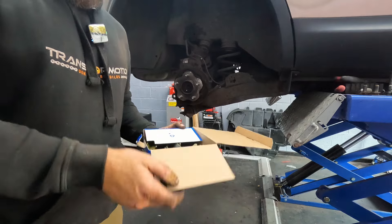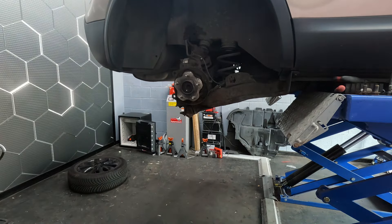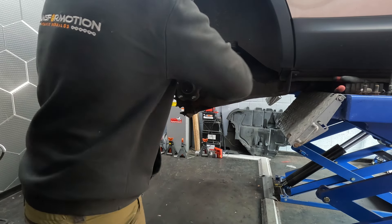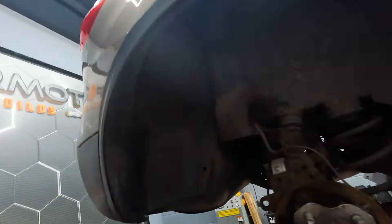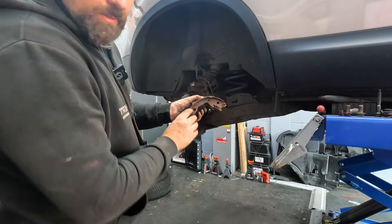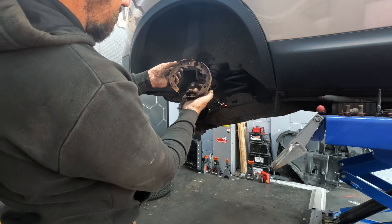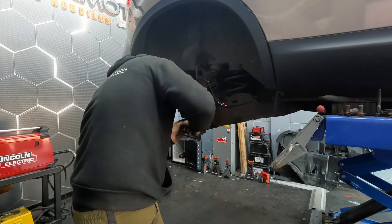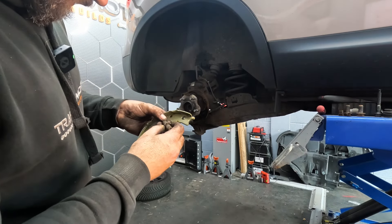Look at them — spanking new shoes. Right, I'll give this a quick clean. I'm putting a tiny bit of grease where the actual shoe is going to sit on the backplate, just to help it move in and out a little bit. Also worth checking whether the shoes are symmetrical — these two are the same, so all four of the new ones should be matching. So that's the arm back on — lovely and free, no issues there.